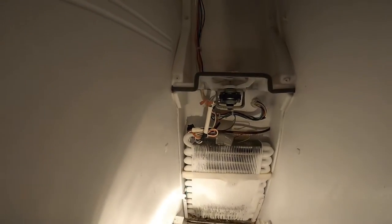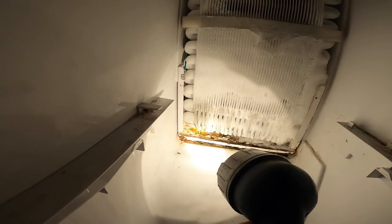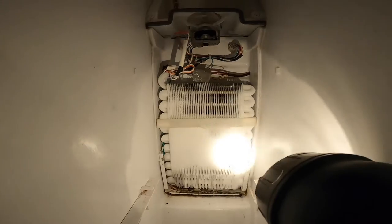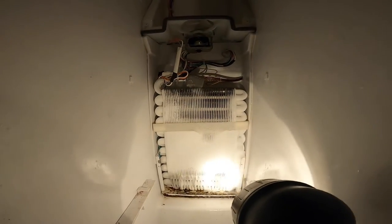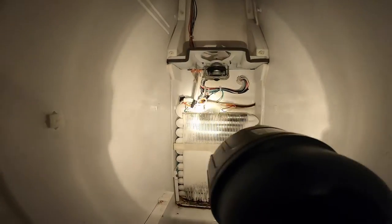The second panel is gone. The light was easy — I just unplugged it from the back and took the lens off. I have a feeling this is what the problem is. I really thought it was based in this drain down here — I thought that would be clogged — but it appears to be open. I'm going to get rid of all this ice and clean this up. I think it's just locked up solid with ice and it's not allowing it to do its function.